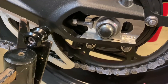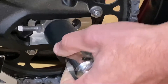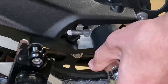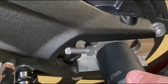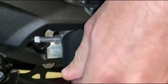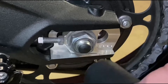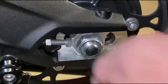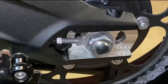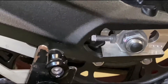We don't have to get it all the way off, we just have to loosen it so I can move the wheel back and forth. So first we're going to loosen this nut — it's a little tough — just loosen it a little bit more.